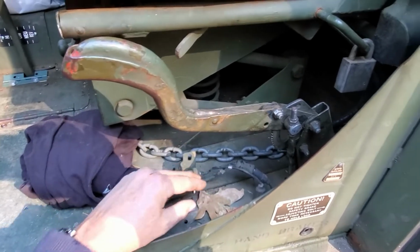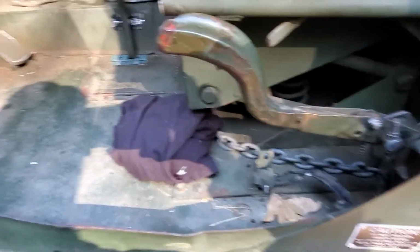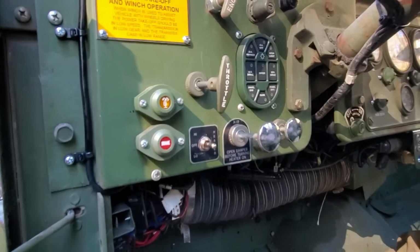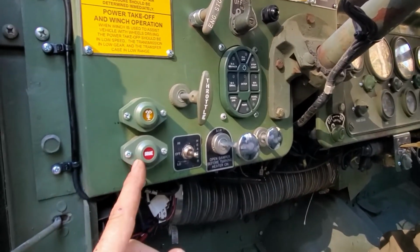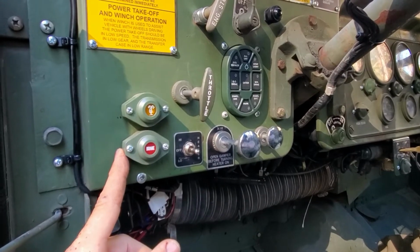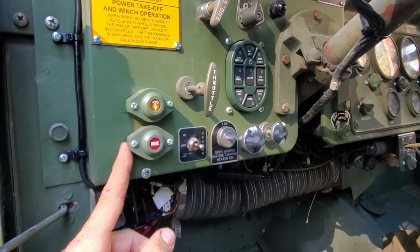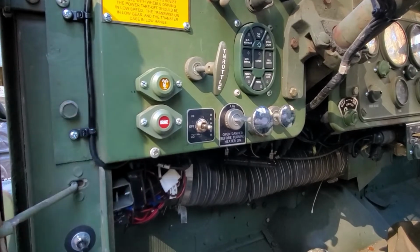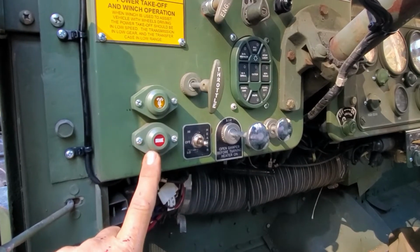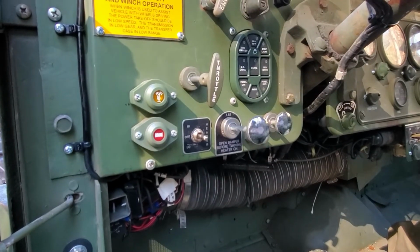Dozens. So since I had this switch here and it wasn't hooked to anything, I went ahead and did this instead. On this part of the dash, which is highly modified, you'll notice this brake light. Now this is a standard brake light. I think even Humvees and things come with these lights already. So I went ahead, again, another eBay thing, bought the brake light and connected it up to that switch, so that when I turn the ignition on, if I have the parking brake up, this light's on, it tells me, oh my goodness, I need to put that down, and when I put it down, the light goes off.